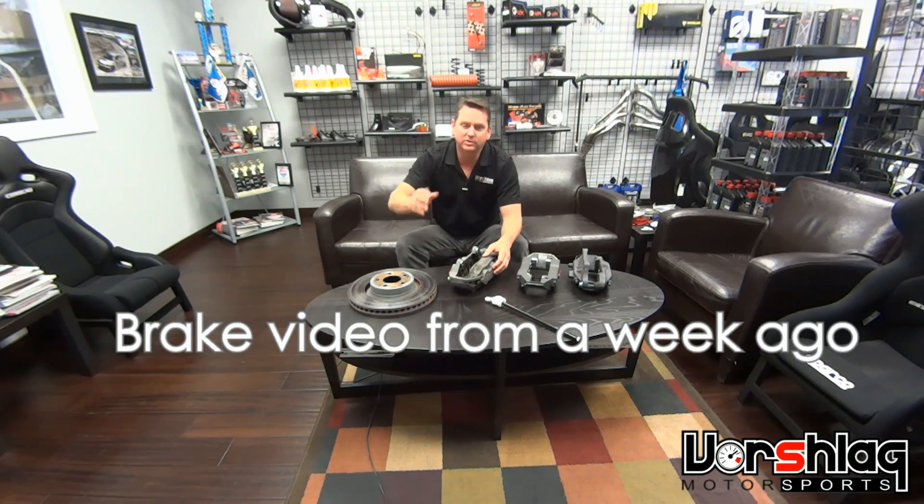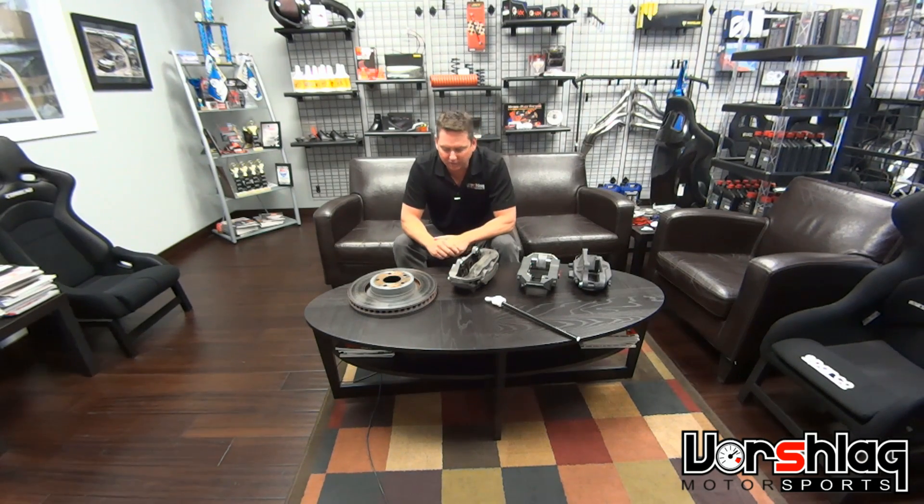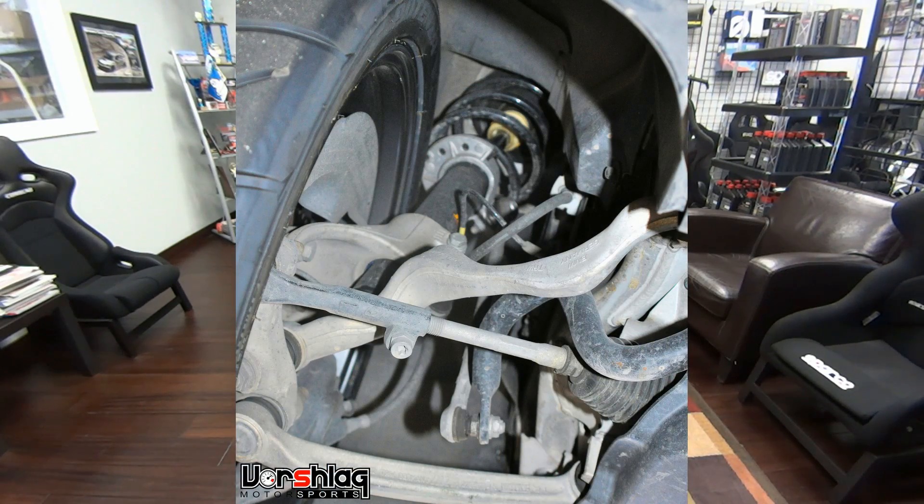My video got thousands of views and it actually reached the original designer of the brake system on the S550 Mustang. He reached out to me and we have a call scheduled this Friday. He no longer works at Ford, so he's not under a gag order anymore. I checked into him — he did work at Ford — and what he told me is that when this chassis was built, they copied a lot of things from German cars. The front suspension has a double ball-jointed A-arm straight out of BMW, the rear suspension is very BMW-esque, and the brake rotors mimicked this inverted hat design from some German automakers — even found on some AMGs — that are typically on luxury cars and don't get driven hard.